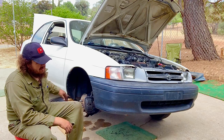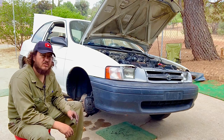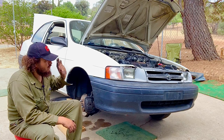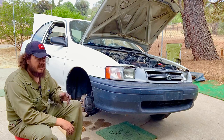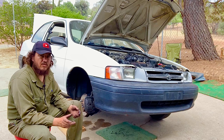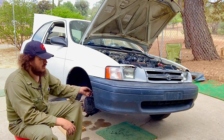We tilted the car towards the driver's side by lifting it from the passenger side. We need clearance on the bottom, and the oil in there is only about a thousand miles old — full synthetic — so we don't want to drain and contaminate it. By tilting, all the oil travels towards the driver's side, so when we pull that seal off the oil doesn't come out. Ideally, do this replacement during an oil change so you drain first, pull the seal, install the new one, then add fresh oil.